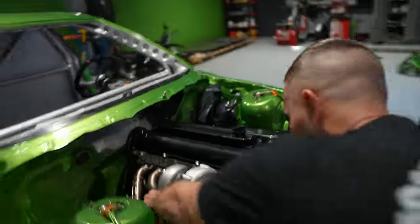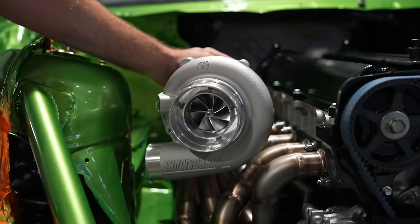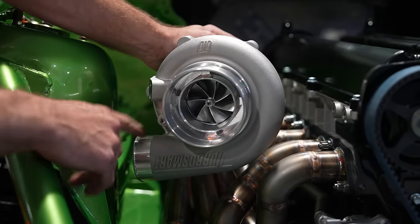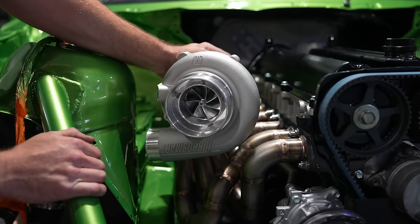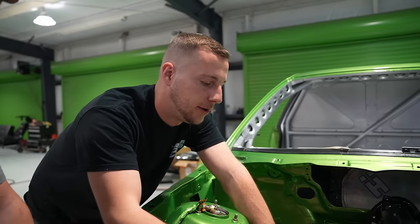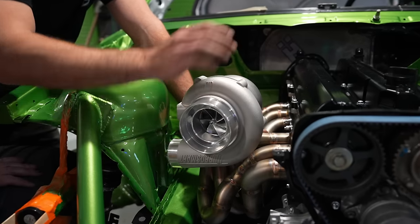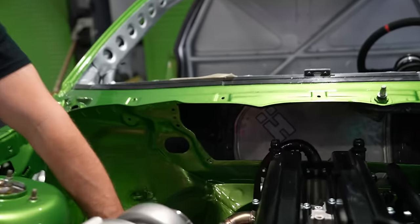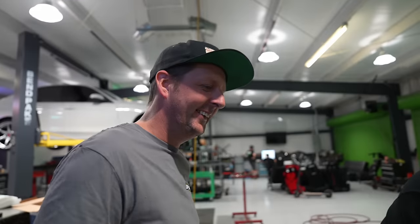Already love it — just locks right in. That's going to look so good in there. Turbos are about aesthetics as much as performance, at least to us. That 2.5-inch outlet instead of the little 2-inch is great. Their hot side turbine is a different, more compact design, and they're able to offer the same power through pressure ratios and AR sizing. We're going to test how efficient they really are. You can also spin the turbo to orient it straight forward or with an outward pitch — I prefer outward for intake routing.